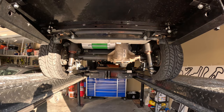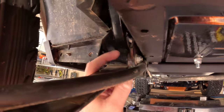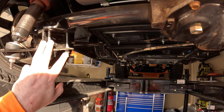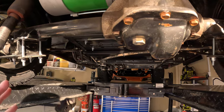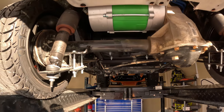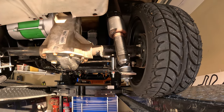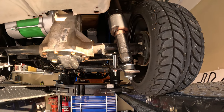It's really not centered up, and I attribute a lot of that to the bushings being pretty worn on both sides. I'm hoping that with the square tube replacement and new bushings up front it might straighten it out. If it doesn't, or if I'm still getting a lot of side-to-side sway, I'll have to figure out a panhard bar solution. I thought I had one figured out but didn't like how it went, so we'll see what it looks like once I get the rear suspension parts ordered and bolted together.